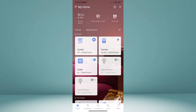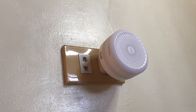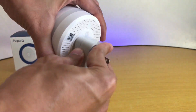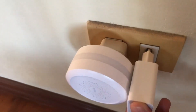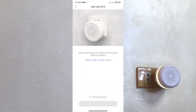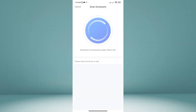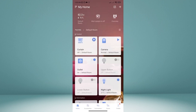Once the app is downloaded, simply create an account and sign in. The app layout will look a bit different if you haven't added any Aqara devices before. To add the Aqara M1S hub, tap the plus sign on the upper right corner, then select M1S hub. Then plug the device into an outlet. Please bear in mind that the hub has a three-pin plug, so if you're living in a country that only has a two-pin plug like mine, you will need an adapter. Because of its size, it might take some space in your outlet depending on the configuration. Once it's plugged in, the LED ring light will start blinking. If not, press the side button for 10 seconds — the hub will automatically go into pairing mode. Simply follow the on-screen instructions and you should be fine. Once the device is added, you can see it from the Home tab. If not, go to the Accessories tab.